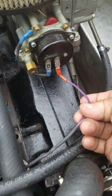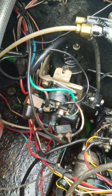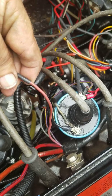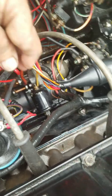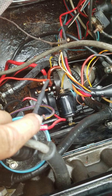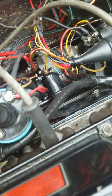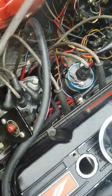This purple wire actually started out — let me get in here — it is originally the reddish-brownish looking wire. If you trace it back through the harness, it is purple. It was originally connected right here. See where I cut it off? This other wire is yellow and purple right there. The purple wire — I left it purple and wired more purple wire onto it — is the resistor wire.